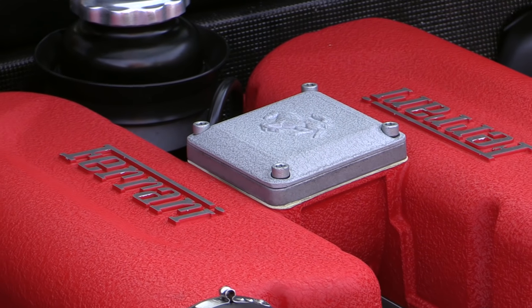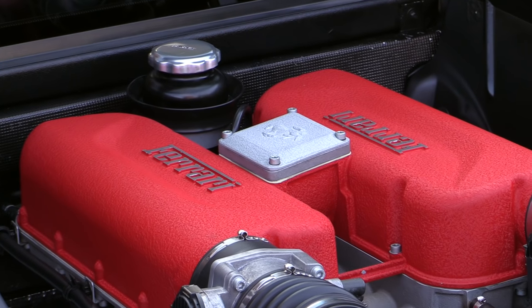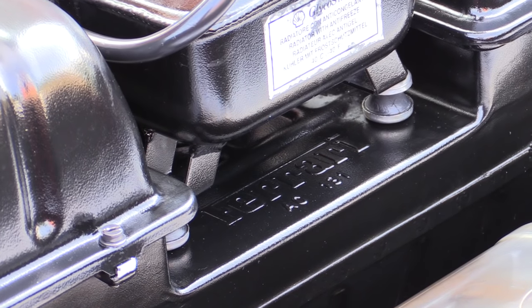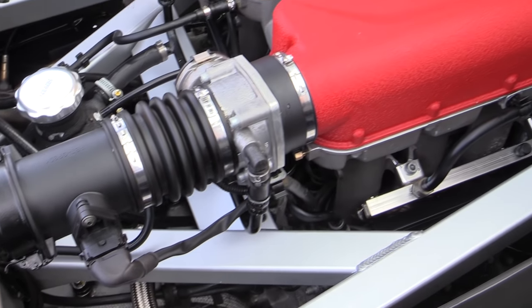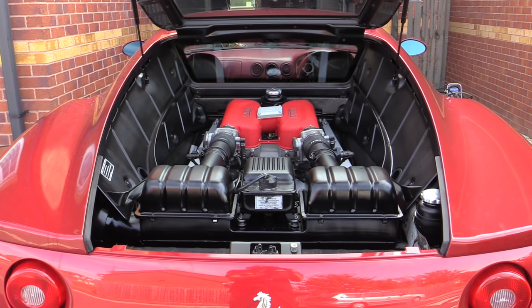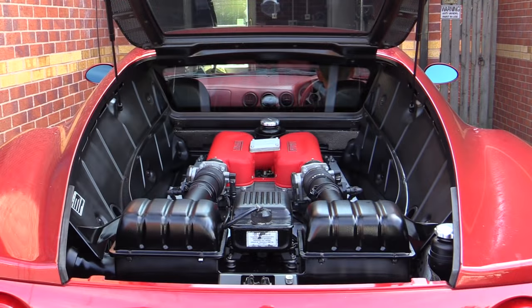And that was that — job complete. A fairly straightforward four-step process of covering, cleaning, dressing and drying, which minus the time with the camera probably took me somewhere around three hours to complete. As stated earlier, this isn't something you would expose your supercar engine to frequently; however, a deep clean once in a while shouldn't do any significant harm so long as exposed areas are adequately covered, streams of water are kept moving and the engine is thoroughly dried off afterwards. Subsequent maintenance cleaning including a wipe down with a damp microfibre towel primed with a little all-purpose cleaner and a light reapplication of the dressing should then help to keep things looking good and protected from the elements. All that was left to do was to fire the beast up, allowing the warmth of the engine on tick-over to dry off any remaining unseen moisture as well as fully cure the protectant. As always, thanks for watching, be sure to subscribe to catch more car cleaning action, and happy engine bay day!